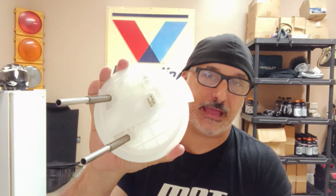You also should have some factory marks that kind of index that thing for you. One other thing, for the gasket, there's a rubber O-ring gasket that goes at the top of this. I would recommend putting a light coating of motor oil or something like that on it just to make that lock ring kind of seat down and not grab that rubber as you're locking it in.